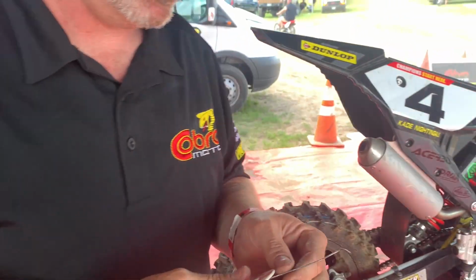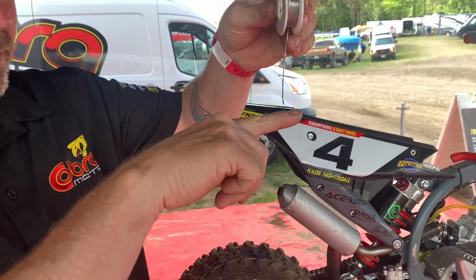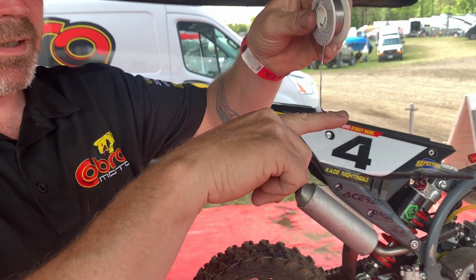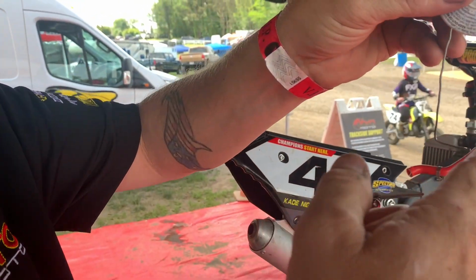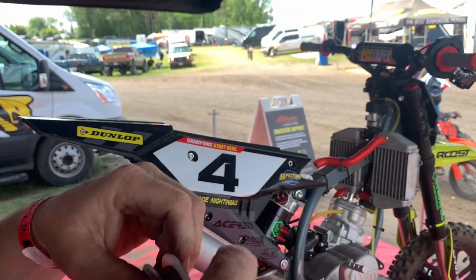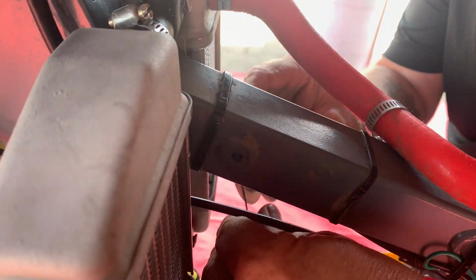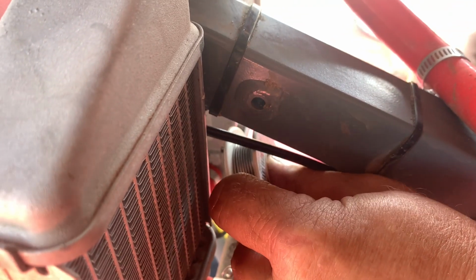All right. What's the 90-degree bend for? Because I'm going to go in my bore. The piston's going to be here. This is going to be touching the side of the bore, all the way to the outside of the cylinder. So I'm going to go in, make sure I'm against the side,